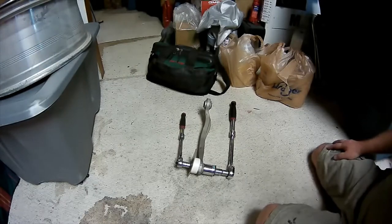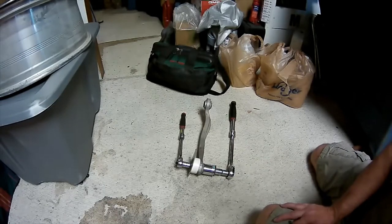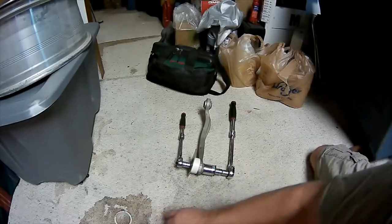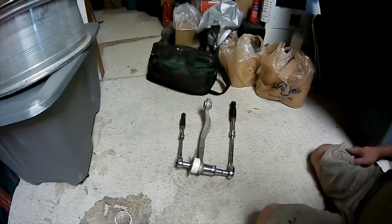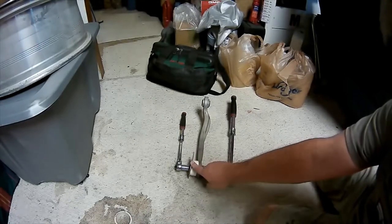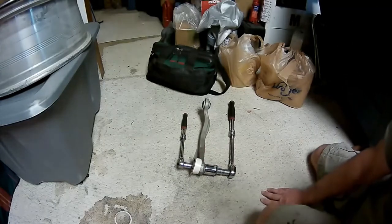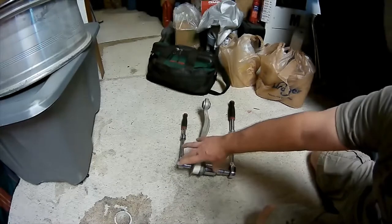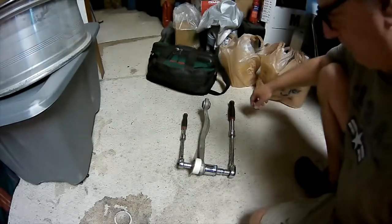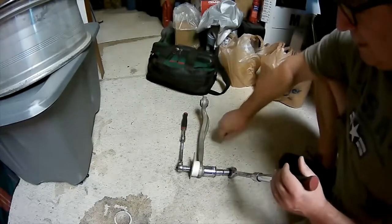Alright folks, I'm back again. I've got my DIY bushing press set up. I had this leftover from when I replaced the bushings in the control arms on my '65 Fury - I have yet to post a video of that, I did it a couple years ago. I've got a 30mm socket, a plate like a concrete anchor plate, and a thick washer on the backside - and it's just a standard bolt, actually leftover from the suspension. Sure, you can buy all kinds of fancy stuff on the internet to do this, but this is what I have.